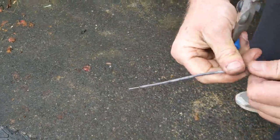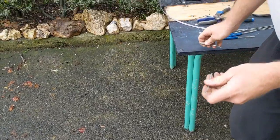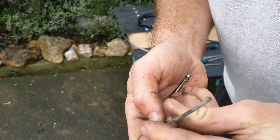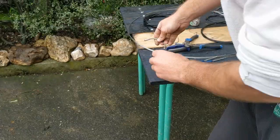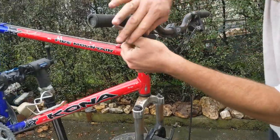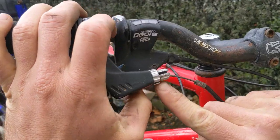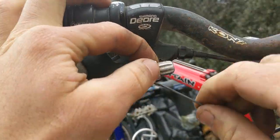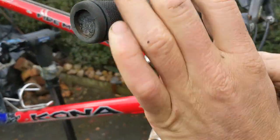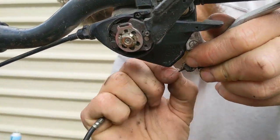So I'm actually going to cut that there and pull that little plastic piece off here. It's a little plastic sleeve that doesn't always come out, but it's come out now — that's to help the cable move nice and freely. So keep all your parts to the side. You need to adjust these little barrels — you're going to line them up and pull the cable out. There's a little piece here; you've got to fiddle around with it to get it out. Got it out.